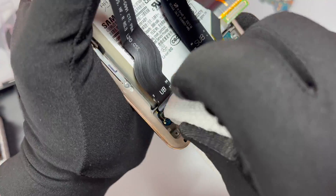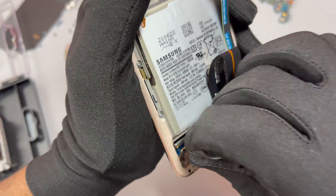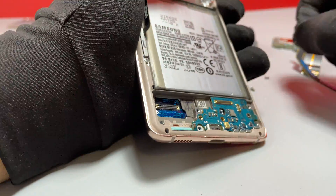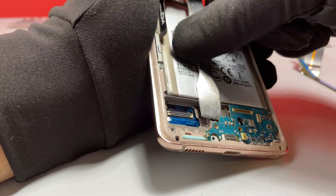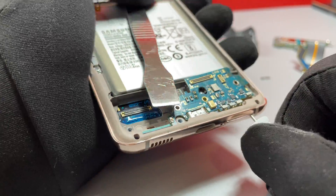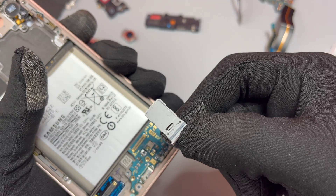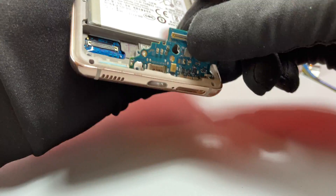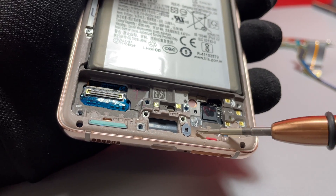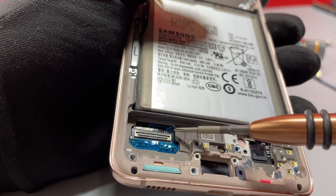The loudspeaker is full of water, and under the loudspeaker we have some water also, so maybe the seals on the back cover gave up as well. We need to remove all the flex cables connected to the charging module, then remove the charging module to assess the water underneath it. The charging module is paired with the sim card module, so we need to remove the sim card tray first. As you can see, the sim card tray also has water on it — this is very strange since the tray was in place. The charging module is out, all components are wet, and there's water under the charging module where the sim card module sits.